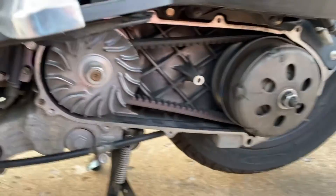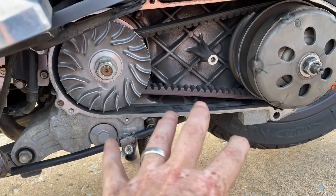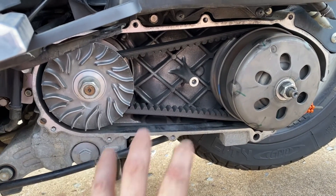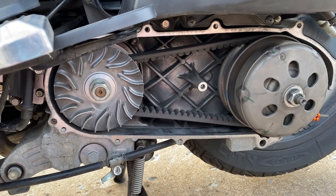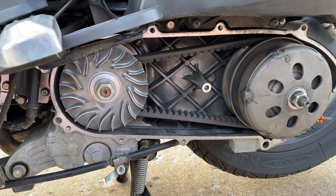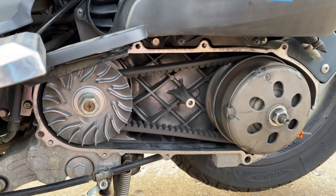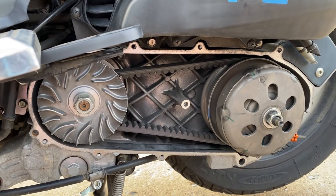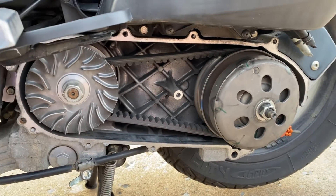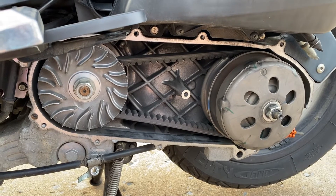In a car, a CVT is going to be a little different because you're going to have, underneath all of this, a valve body which handles pressure from oils. This is an air-cooled CVT. A liquid CVT is cooled and pressures are handled by a valve body in the bottom, which allows it to simulate the shifting of gears even though there are no real gears actually being shifted. So there you go — CVT 101. Not very complicated, not very difficult.